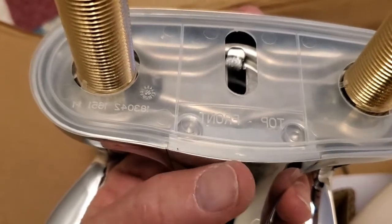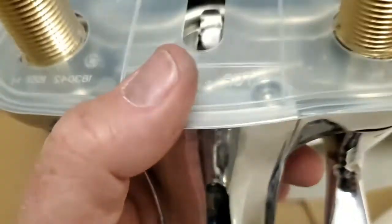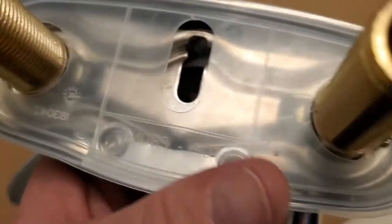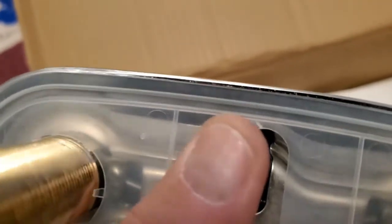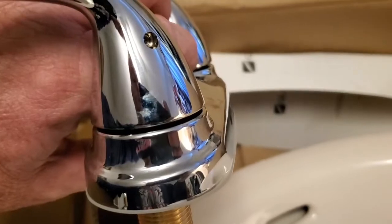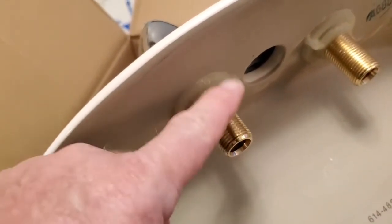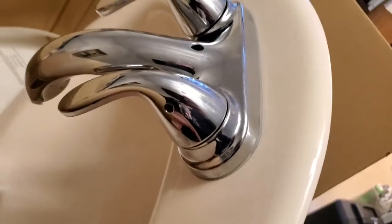When you put the seal on, you can see it says 'top front.' There's a little lip in there — this thing should be sticking out just a little bit all the way around. Make sure it is when you're done because that's what's making your seal. If it goes in and you can see the metal showing, you don't want that — you want it just a little bit out all the way around. Got my nuts tight and my seal showing all the way around — now we're pretty much ready to drop this in.